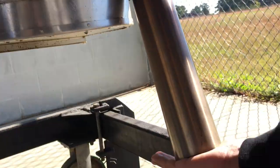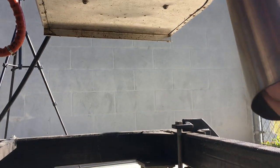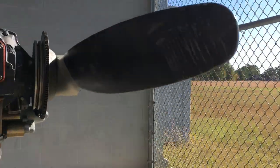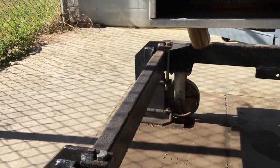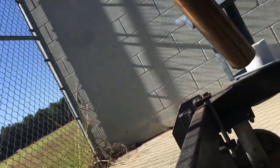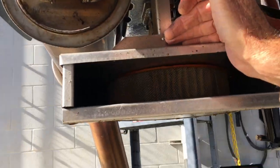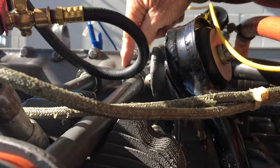If you hear it coming from the exhaust, that's a leak in the exhaust. You listen at the exhaust. There's not a leak coming from the exhaust — nothing significant. So let's walk around again. There's one other place where the leak can be happening. I'm going to put my ear here to this intake. I don't really hear anything coming from there.